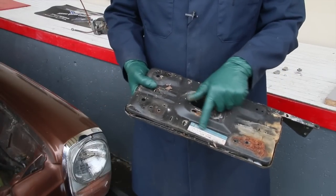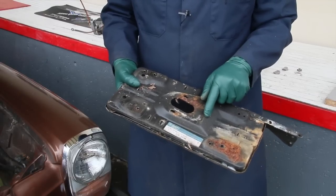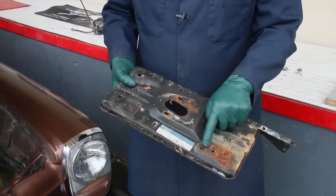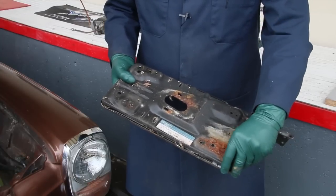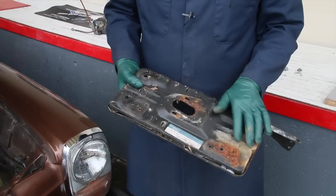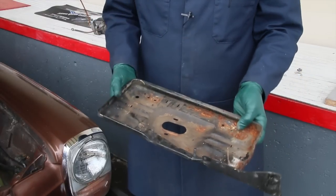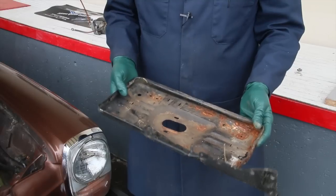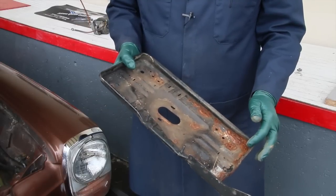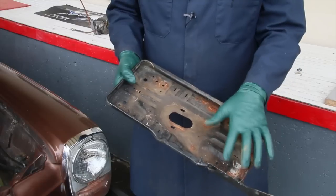See that? It's got a Mercedes sticker on it, meaning this has been a replacement tray. But look at the rust forming here. Once it starts forming, you can see how it's just growing and growing and eventually this whole area right in here will rust away. So we're going to treat this now with Miracle Paint, and a little bit later in the video I'll show you some of the things we're going to do to prep it to stop the rust.